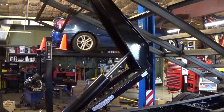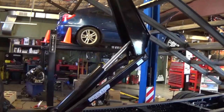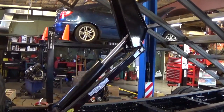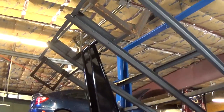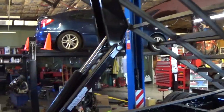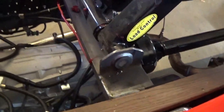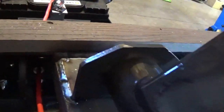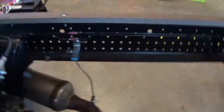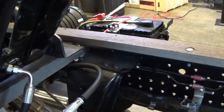As you can see, that's a pretty heavy-duty arm — this is supposed to be a 20,000-pound unit, though that's going to depend on the distance between your two hinge points. We welded the mechanism to some four-inch heavy wall channel and then welded the channel to the frame of the truck. We got lucky on this truck because it positioned right where the transmission crossmember is, giving us a little extra support.